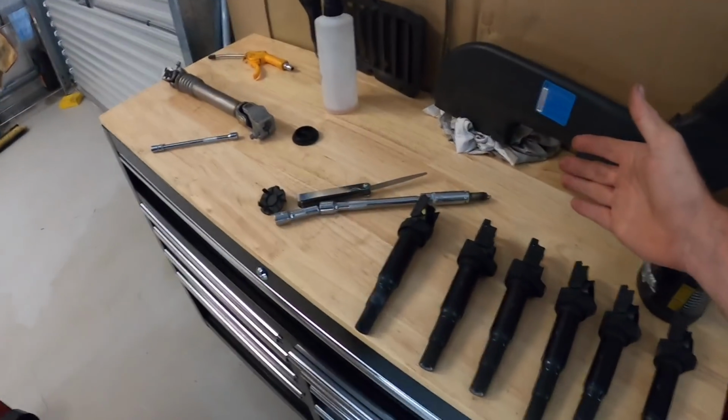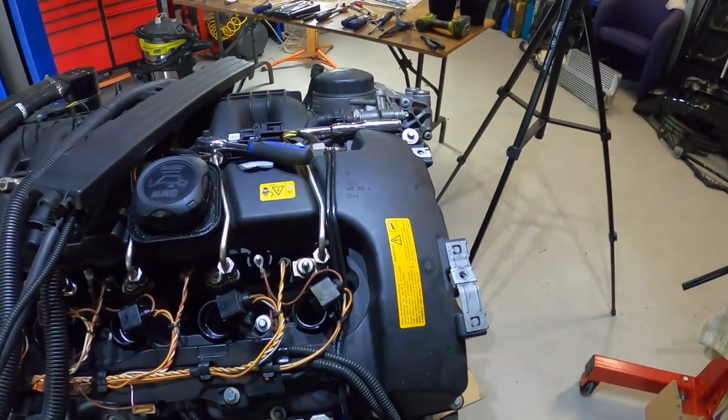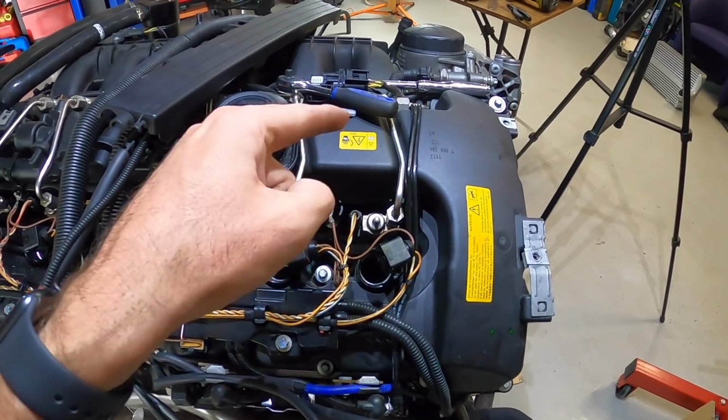It was not misfiring. In fact, it was firing too well, which is why it's probably bent the rod and damaged the ringland. And then we'll swap the injectors in as well. I know the internet's going to hate me for this, but I'm going to try reusing the injector seals.